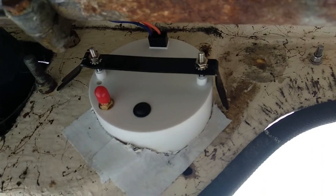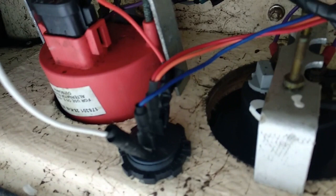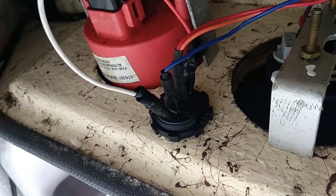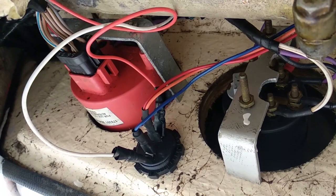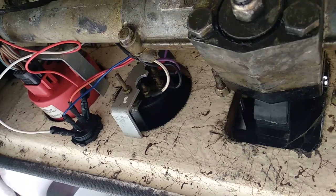This unit has now been mounted in with the bracket on the back. I've got the wires running from the plug along the top, and I've used some piggyback crimps to run them off the back of the LED voltmeter — heat shrink and then wrapped in insulation tape to bind them. Everything is now running off that. The voltmeter was running off the accessory, spliced off from the original OMC gear, so instead of re-splicing another one I decided to run in parallel off that. Basically when the running gear goes into accessory, the voltmeter will kick in and the GPS unit will turn on, giving it time to get a head start before I turn the motor over.